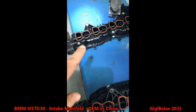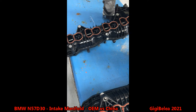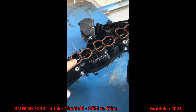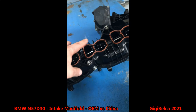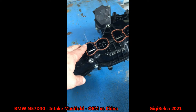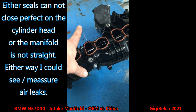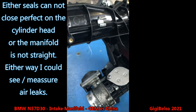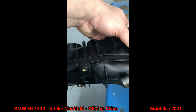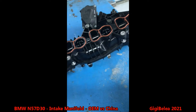Why am I putting the OEM back? I installed the aftermarket one new and made a smoke test — I always had a leak somewhere. I made the smoke test, and I could see smoke coming out. When the manifold is sitting in the car, there's always smoke coming out between the first and second piston.